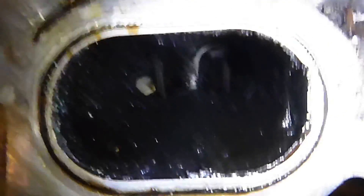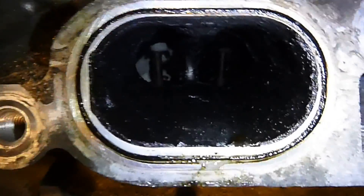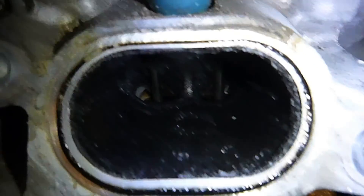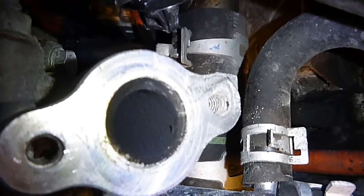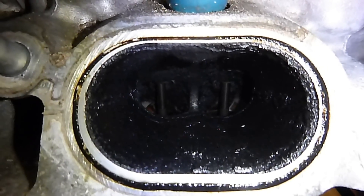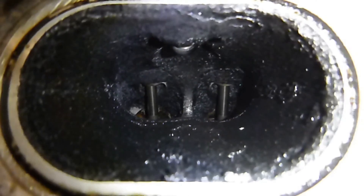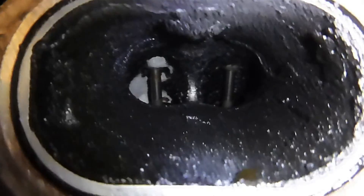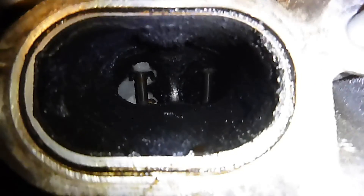There's a ring of oil around the intake — it's an indication that there's a lot of oil going through the intake, coming from the EGR or the PCV. I'm inclined to believe it might be coming from the EGR. These freaking engines burn oil like crazy and then they blow it back into the intake. You get this oily carbon buildup that fouls up your spark plugs, fouls up your EGR, fouls up everything. Good oil rings will fix this problem — just replace the engine.